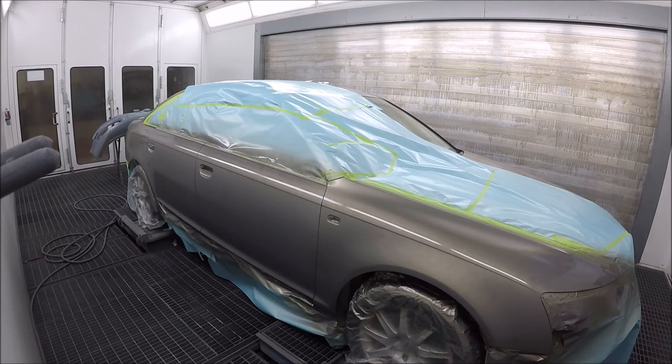A little trick I use: I turn off the lights and then get the 3M sun gun to check everywhere there was primer. I didn't do it on this one because I knew I had good coverage, but for silvers or even black — because black sometimes doesn't cover very well with PPG — I use the 3M light. You turn off the lights inside the booth and point the light at the vehicle. The primer spots will be highlighted, and ironically you can actually see better with the lights off. That's how I make sure I get good coverage, because I've had to redo cars before where I took them into the sun and could see where the base didn't cover.